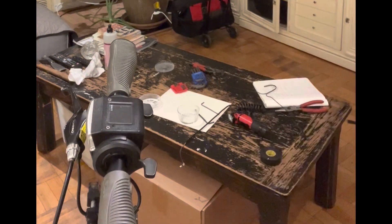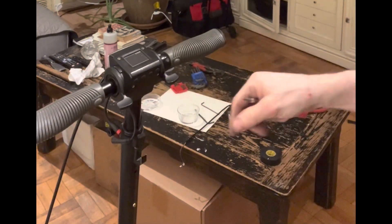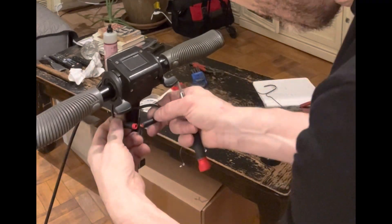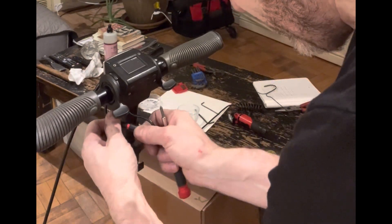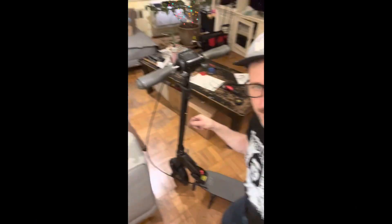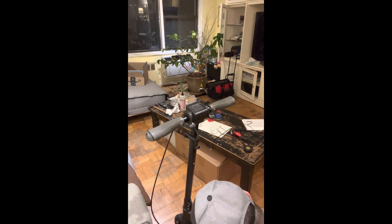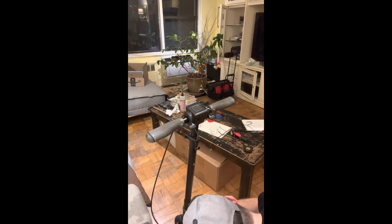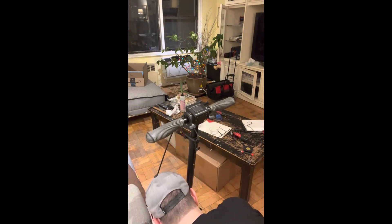I'm going to plug the motor back in and plug the controller wire back in, and the rear brake. On these connectors there's a little arrow that lines up — make sure you look for the two arrows, line them up, and then push them together. Same thing for the controller wire — there are two arrows that line up and a little notch. Make sure all those line up properly before trying to squeeze them so you don't bend the pins. Then put the motor wire back together the same way.